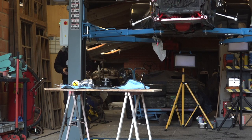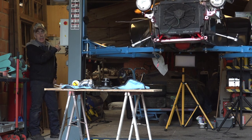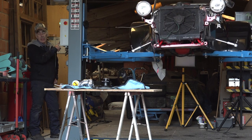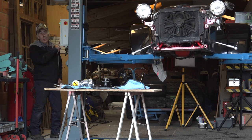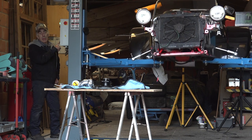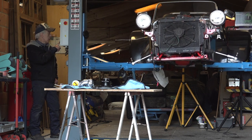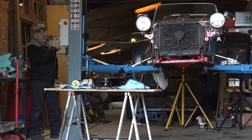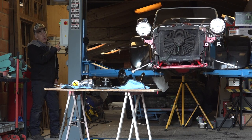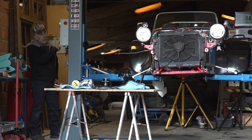The next thing is to flush the brake pipes. The way I'll do this is by connecting a plastic bottle to the brake pipes at each of the four corners of the vehicle. None of them are hooked up to any rear brake cylinders or calipers, so I'll be able to flush through all these pipes. I'm going to try this by pumping the master cylinder — I'm not sure if that master cylinder is alright or not, so that's something we'll have to find out. It's been sitting there for a very long time.